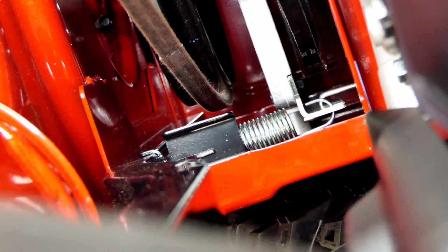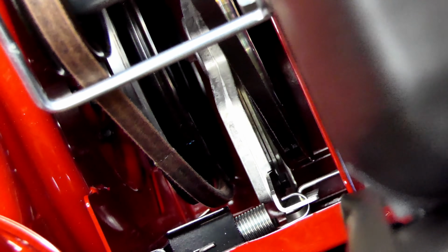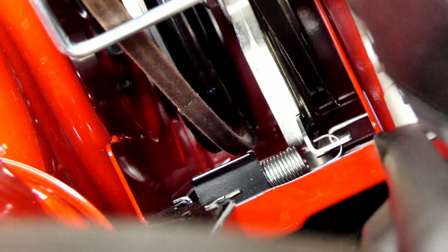So moving around to the other side of that belt area, like I said, the transmission belt is a constant pressure. So when you pull on this, it actually just moves the drive plate for the friction. So you can see the springs working there, but the belt itself doesn't release. And that's a good system. It's a good, simple system. It works. It just works all the time.